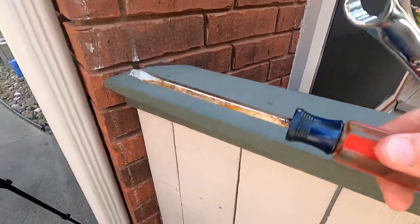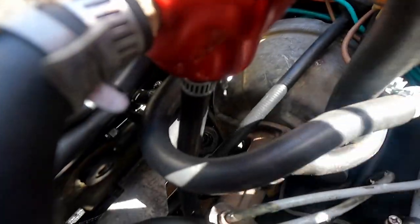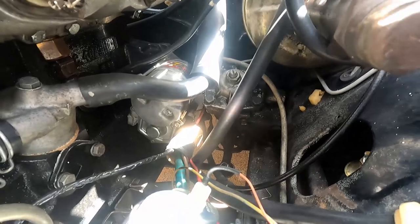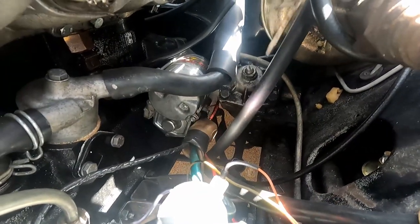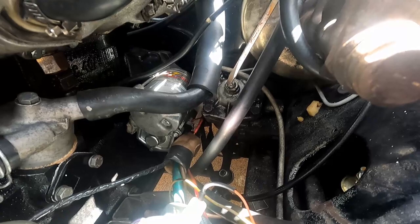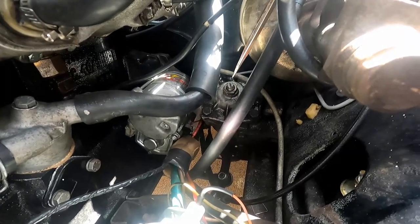What we're going to have to do is take our 19 millimeter wrench and a long flathead screwdriver. We're going to crack that nut on the top — that's going to loosen it. Then with the flathead in the screw from the top, we're going to turn it a quarter turn at a time, and that's going to slowly start tightening up our steering.